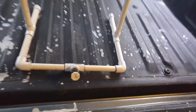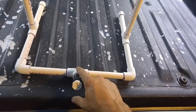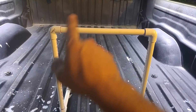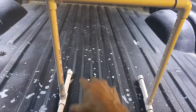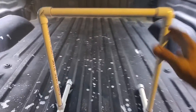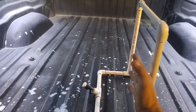The water is going to come from the bucket and the pump — which I have yet to order — get pumped through here, come in here, go this way and this way, go up both sides, and then drizzle out down here to soak the evaporative cooling pad. The fan is going to be sitting right here, sucking all that cold air and blowing it out.